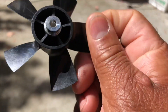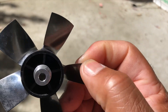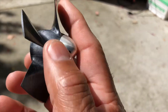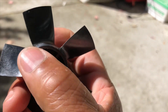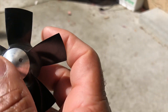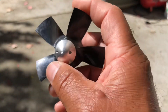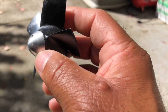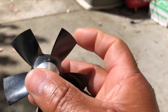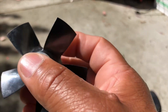Since these are five blades, it's a little bit different. If you look on the back, you'll see there are little compartments, and inside it's actually numbered one through five. The blade itself lines up with that little compartment on the back. First, run it up and see if there's any vibration — you may not necessarily feel it, but if you hold the fan housing close to the table like I've shown in other videos, you can see and feel the vibration.